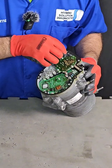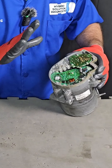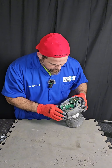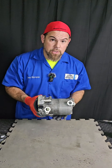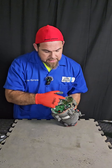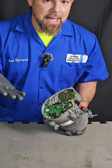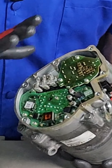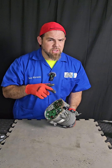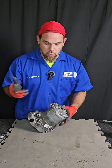I don't see any oil. Let me see if by chance there's a little oil over here — absolutely not. Am I seeing any burning marks? No, they all look good. So far, so good. We understand that a high voltage AC compressor receives positive and negative directly from the high voltage battery, and using this inverter it turns into three-phase AC high voltage to run a variable speed electric motor via this three-phase connector. I'm not going to take this out because I want to find out if, as is most often the case, European vehicles have a mechanical failure.